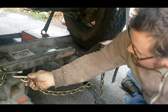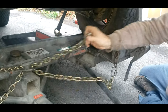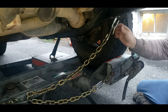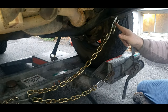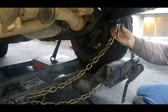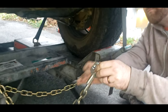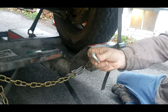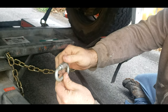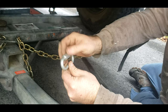With both tires strapped in, go ahead and add the safety chains. These give an extra layer of redundancy in case both ratchet straps fail. Wrap them through the dolly and connect them to a secure point on the chassis of the car. In our case the chain was just too short — this is a lifted vehicle — so we had to use a threaded adapter. The threaded links are very strong; some are actually rated higher than the chain links they attach to. Use something rated for this application.